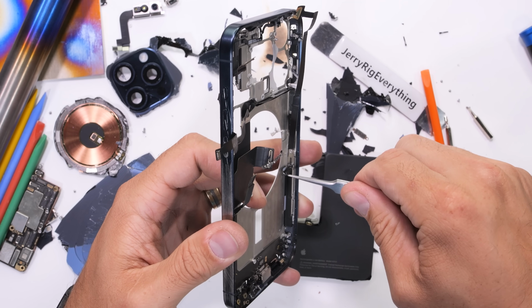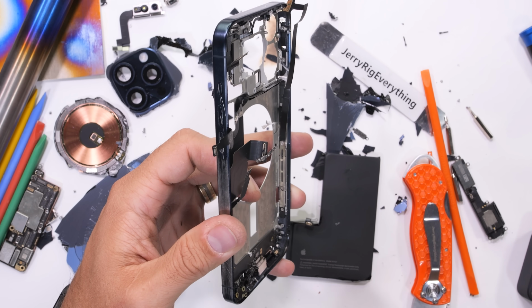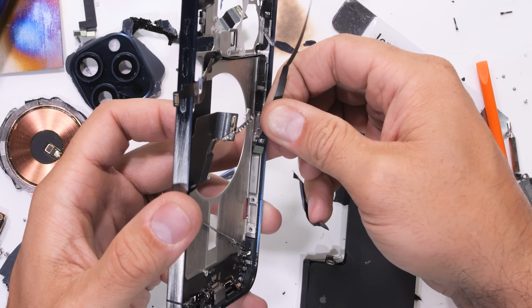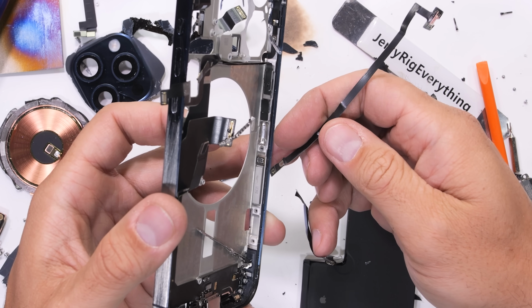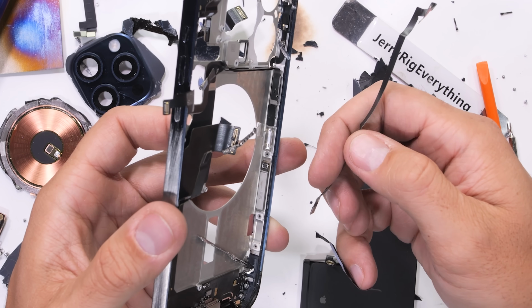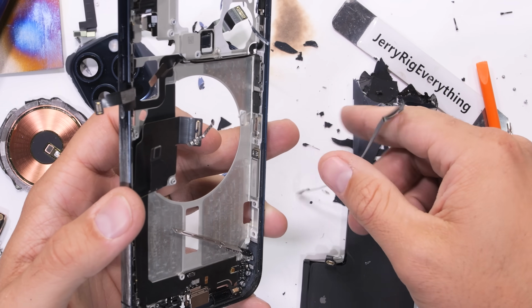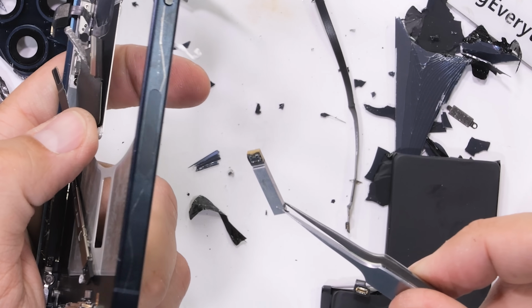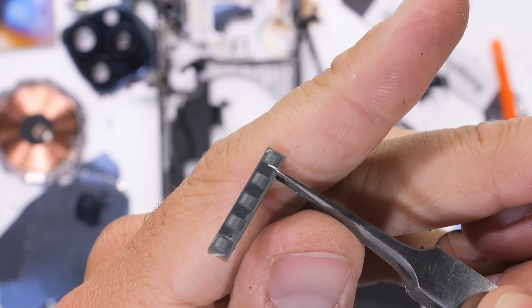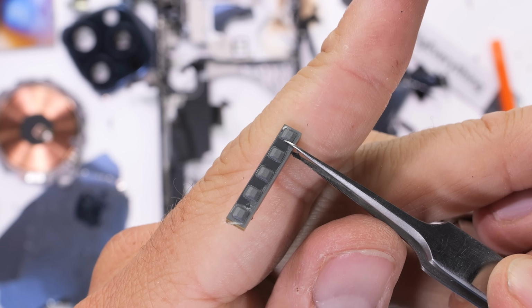I can remove a few more screws that are holding the 5G antenna to the frame of the phone. It looks like this is indeed what was soldered to the back of the motherboard. Super strange. I wonder if a Lego-style ribbon connector on a cable this long just doesn't have the bandwidth needed to handle 5G. The whole phone design is kind of whack. It's like someone's friend owns a tiny screw factory and Apple is single-handedly trying to keep them in business.